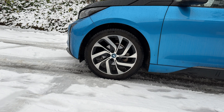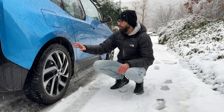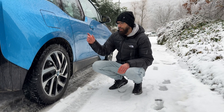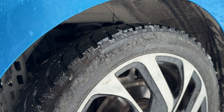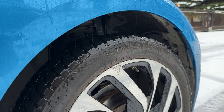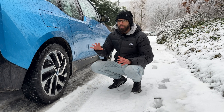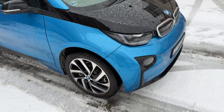The car is on the stock rims which are slightly wider in the rear, so it's a staggered setup which means we had to go for wider rear winter tires. Officially you should go for Bridgestone Blizzak all around, using the 155mm wide tire on a 5J wheel, whereas here because this is a 5.5J on the rear we had to go for the Nankangs. I believe these are not made anymore and it's not an official BMW recommended setup — on the front it's the Bridgestones. With i3s we have seen them freak out a little bit if you mix tires across the entire car, so ideally go for the Bridgestones all around.